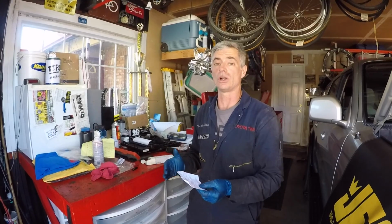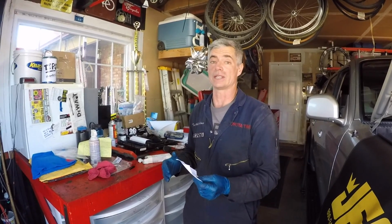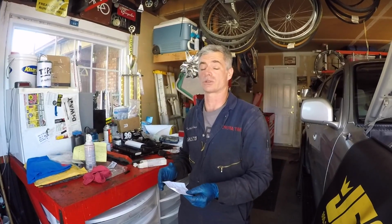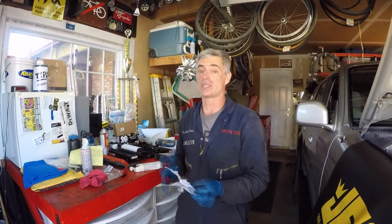Depending on your vehicle, you'll have to look at the specs for what operating temperature is. On the 3rd generation Toyota 4Runner, it's a temperature range between 158 and 176. If you have a way to monitor your temperatures through some type of OBD2 reader to a phone app like Torque Pro, or you have a ScanGauge, that would be ideal.